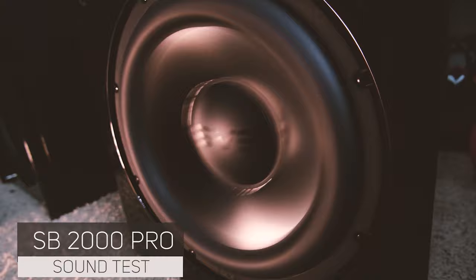Let's talk a little bit about sealed enclosures. The SB2000 Pro is a sealed enclosure. The benefit is that it's so small it could fit almost anywhere — it's a 12-inch subwoofer, but it's only 15 by 15. Sealed enclosures are generally more accurate in frequency response and better at rendering instrumentals in a convincing way, making them a natural choice for musical applications. Don't count them out on home theater either, because they can get pretty low — they're not going to get as loud as ported subwoofers, but they do pack quite the punch. The trapped air inside a sealed enclosure acts as a spring, dampening the movement of the speaker and smoothly modulating its back-and-forth motion so all notes get produced evenly — translating into very crisp and clean bass output.